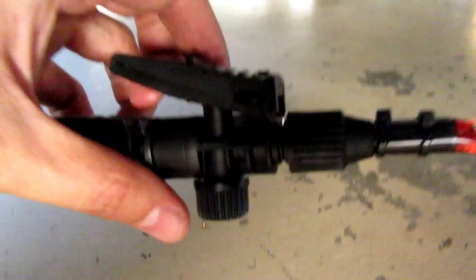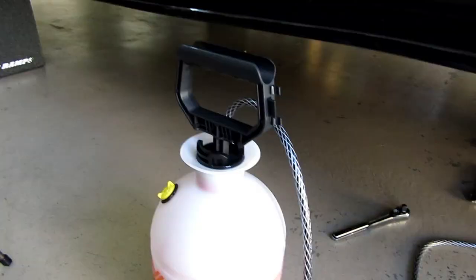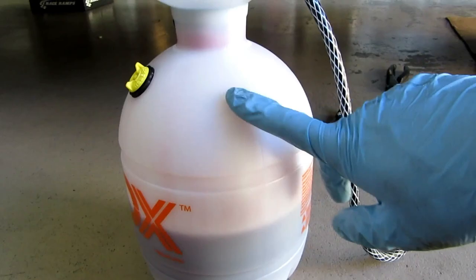What we're doing is taking some of the old transmission fluid out so it's at the full amount. What's nice is you can just take your hand off the trigger to stop pumping. We'll wait for this to stop dripping to get all the old trans fluid out, then plug it up and do it again. This is one gallon, so it should hold four quarts — that's what this transmission on the Corvette takes, mine's about three and a half to four quarts.